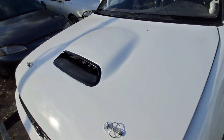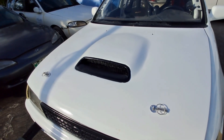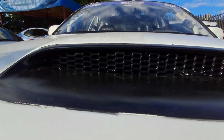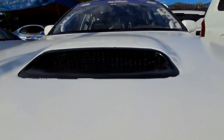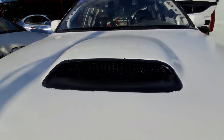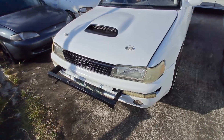If you notice, it's already molded and already has this bump on the hood. Without this bump, the installation of the top-mount intercooler would have been impossible. I'm not exactly sure if there's ample airflow reaching the intercooler — we may need proper ducting — but without this bulge on the hood it would have been impossible to fit any sort of top-mount intercooler on this car. We're very fortunate to have acquired this at a very affordable price. We didn't want to install an intercooler in the front bumper.